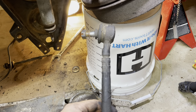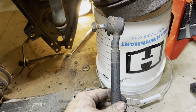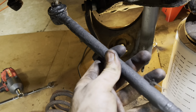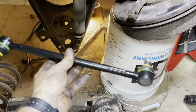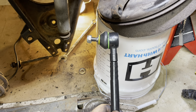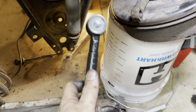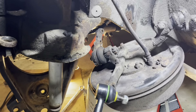I got the tie rod off after a little bit of hammering. These are directional — if you look at the tie rod end, one side is basically straight and if you flip it around you can see that one has an angle on it. The angle should go to the inside, toward the center link or the steering box. Here's the replacement tie rod — you can see the angled side and the straight side. These are also marked for side: this one is stamped L, the other one I have is stamped R. So this is going to be our driver's side. We'll go ahead and get this in and start reassembling the rest of the suspension.